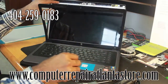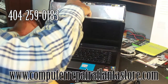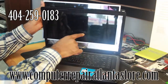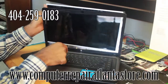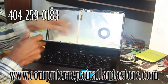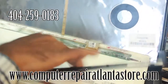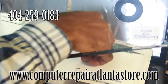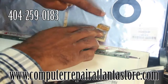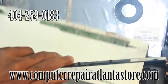I have already pretty much removed it, so what I will do is lean it back this way and remove the video cable from the LCD itself. Just look back in the back. Remove the tape — which you may not be able to see too well — it is right here. Be sure you don't break the bezel like I am bending it. Right here I will take it out, simply removing the LCD video connector cable, then remove the screen.